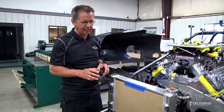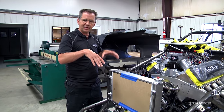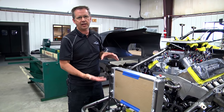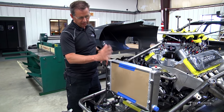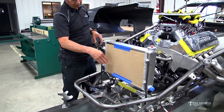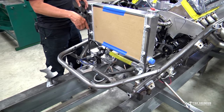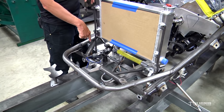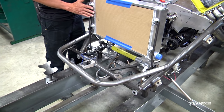That's a nice feature because if you don't do it, when you slide the radiator down in there it kind of locks itself in and you end up trying to pop it out to get it out of the way. So with the mount kit you can make a few modifications to it if you need to — if your frame rail width is different than this, you can just run it straight down to the top of the frame. So we've got the radiator mounted.